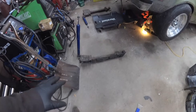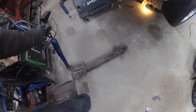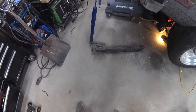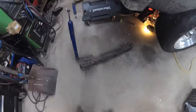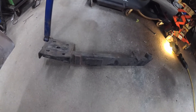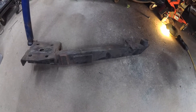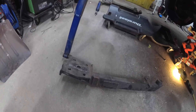These were the slapper bars that were in it — the same exact slapper bars it came with, but I modified them to make it work better for this application. The leaf spring was mounted on top of the axle, like most trucks have the differential under the spring. I cut and modified the slapper bar so the bushing was sitting right under the spring eye, with a little bit of tension on it already. There's some adjustment built into the pad, but I always kept it semi-preloaded and it always worked for me.